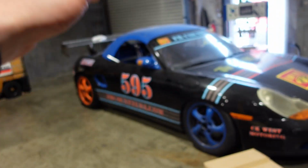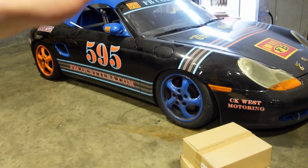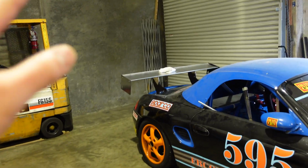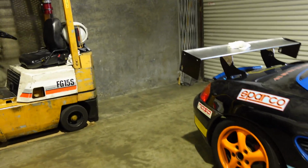All right, so things we gotta do. Number 1, adjust the ride height on the front suspension on all 3 cars, because under load, and especially with the 255s up front, it does rub on the inner fender. We have 1 wing on, so we gotta install 2 more.